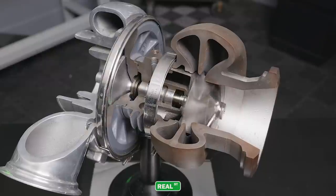The exhaust housing plays a critical role in the turbocharger's operation. The exhaust gas leaving the engine converges in the turbine housing, causing the turbine to spin. Different styles and size exhaust housings can influence the character of the turbocharger in not only response, but total airflow available.